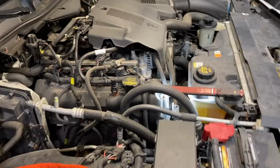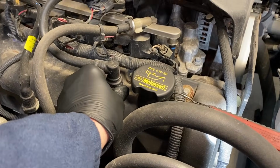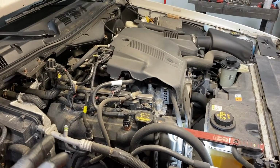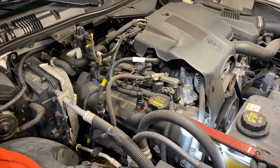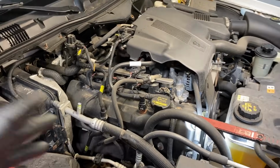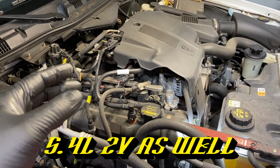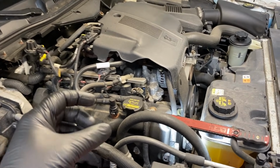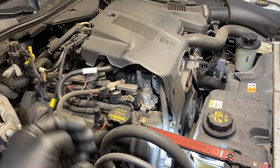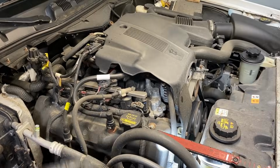So, I can already tell you right now, it's the PCV valve, okay? Right here in the valve cover. Very, very common no matter what year you have. The old metal rattle type ones that are not plastic. For some reason, the 4.6 valve, they have a real issue with these things rattling. They get to the point where they're just kind of fluttering inside of there instead of just being sucked up or down and resting. They kind of vibrate inside of there.